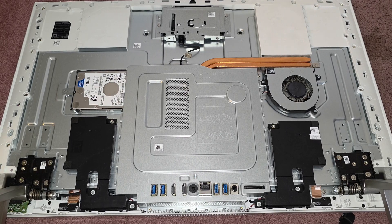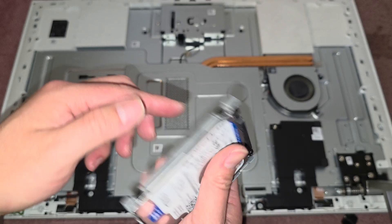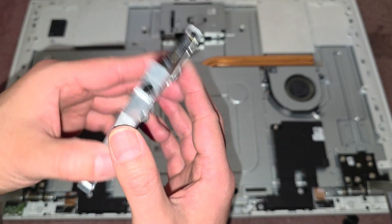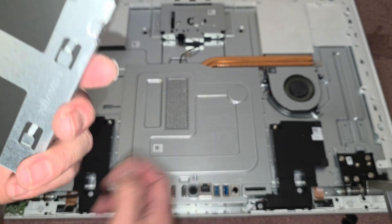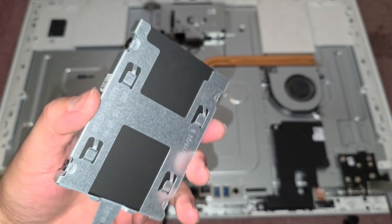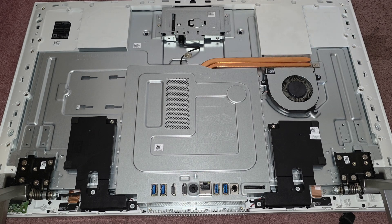If you want to remove the two-and-a-half-inch SATA hard drive, there's one screw here. Remove that and you should be able to just slide that out. There's your two-and-a-half-inch SATA hard drive. There are four screws holding that in place — you'll have to switch to a PH1 screwdriver to take those out. You can put an SSD if you want. If you're going to do that and the operating system is on here, you are going to have to either clone the hard drive to the new drive or be ready to reinstall Windows.